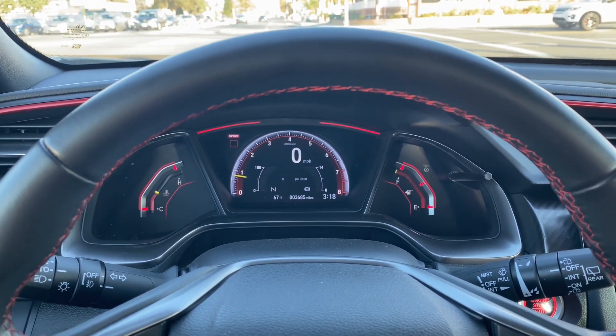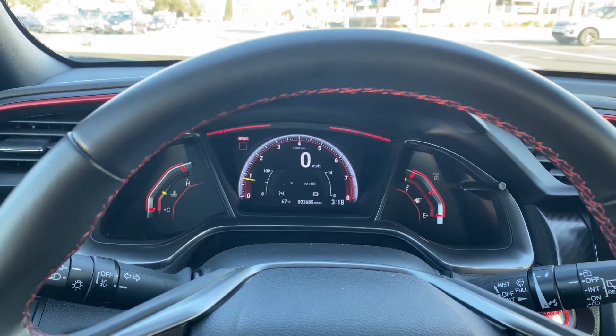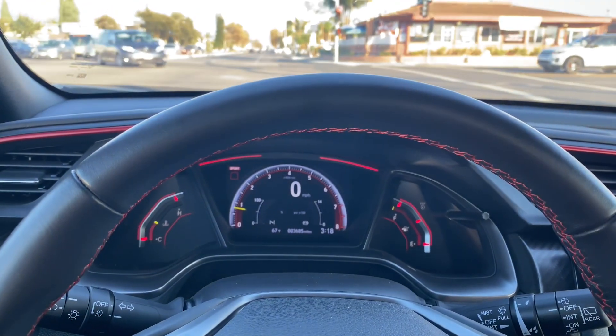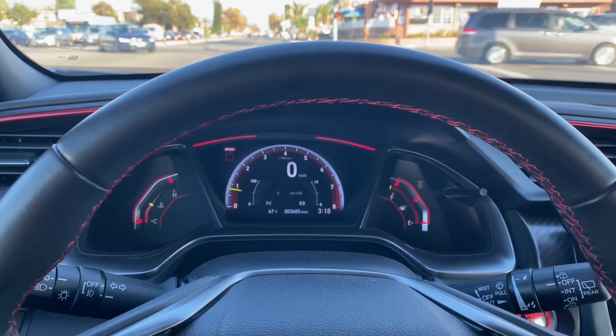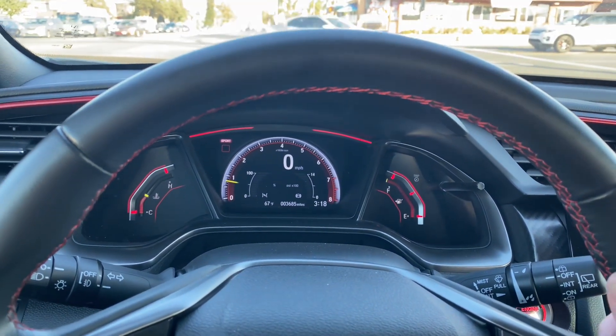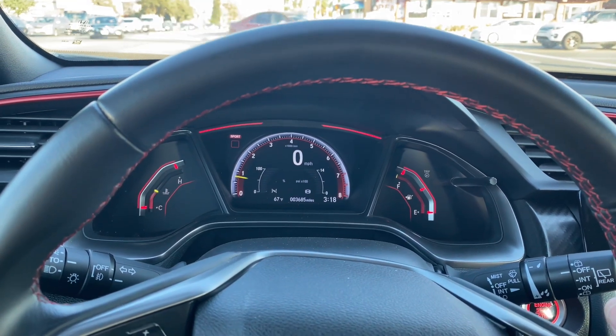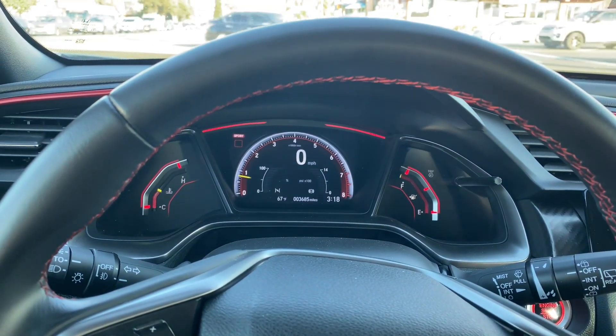I think that dip is probably due to tuning, because we haven't tuned the car yet with this new throttle body — this is the only change we've made. But when you're actually driving, it absolutely never does that. It only happens if I sit there and rev it while at idle.